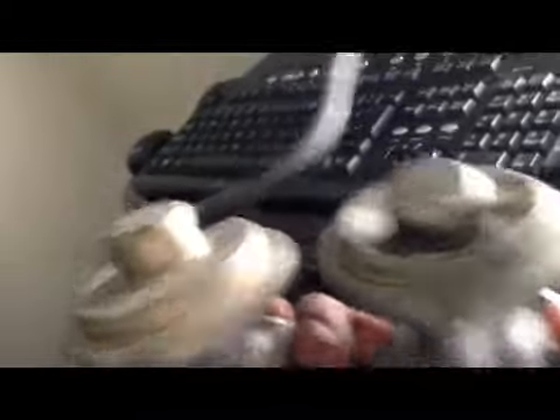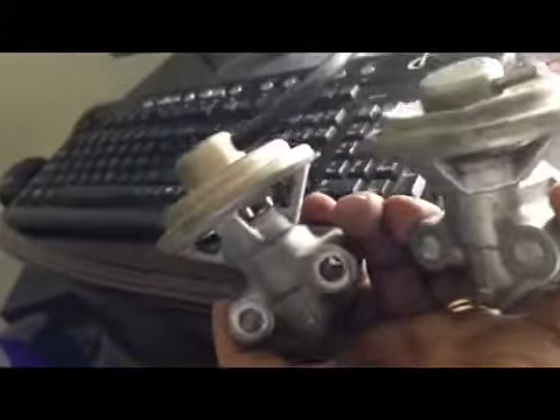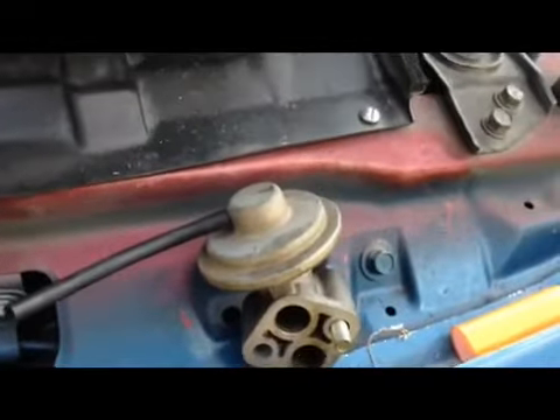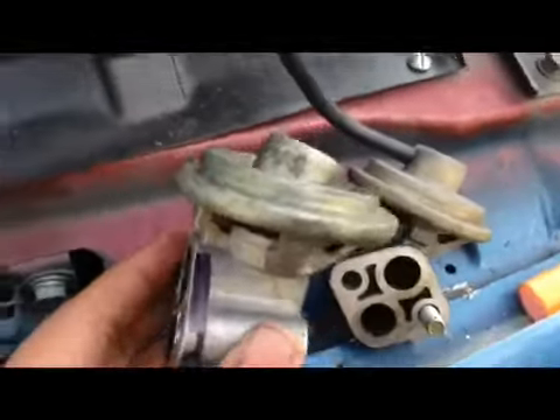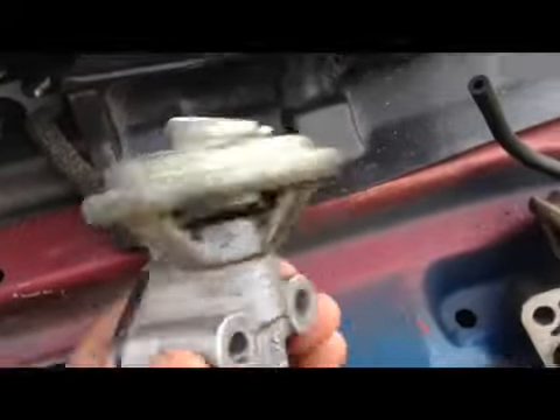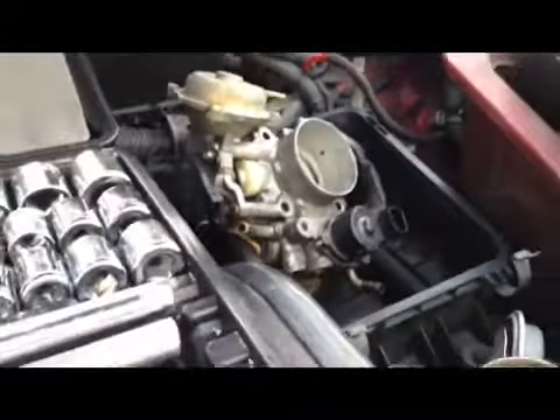I have to get the hose because the hose in here got broken — it got pinched right there. So I have to get the hose off this one, uninstall it, and let it run. But I need to clean it first. Here's the fun part — that's the new one, that's the old one. I still don't know how this thing got bent. And that's my throttle body — I cleaned it and everything.